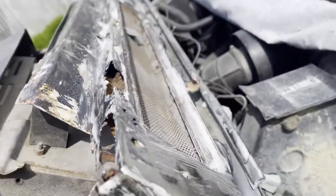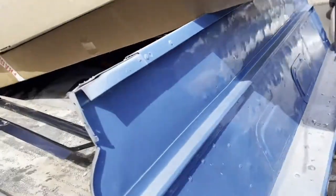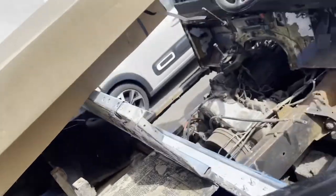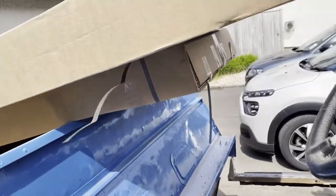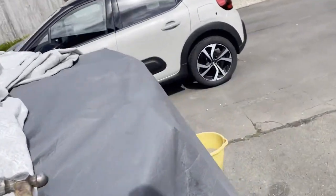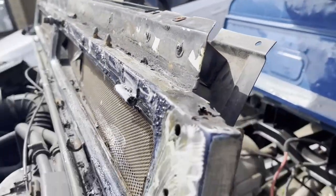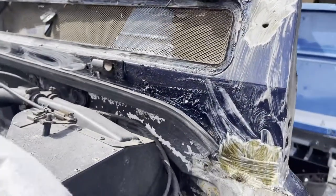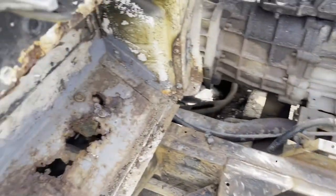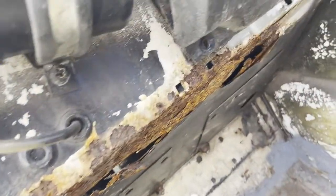All these big nasty holes. There's some paint stripper on there at the moment so we can just get it back to the raw metal. We've got this repair panel which will go on the outside. I've got a similar one on the other side but it's a bit smaller because I don't need the full length one. This side's in better condition — well, it's more sound. So let's get this rusty hole cut out, and this part here.